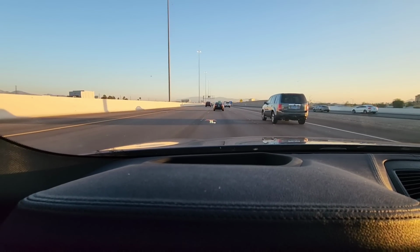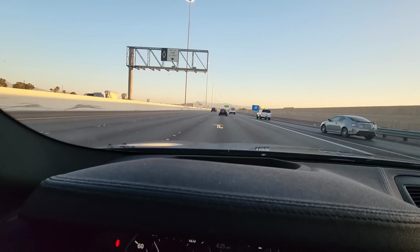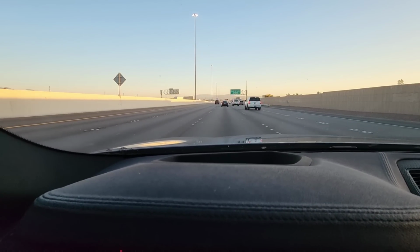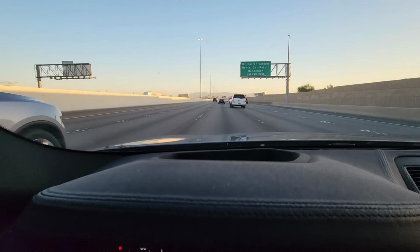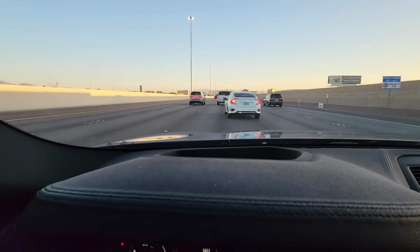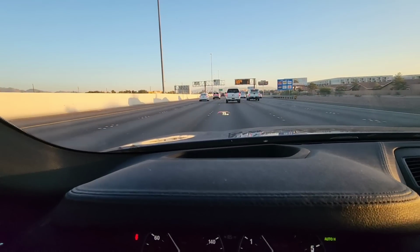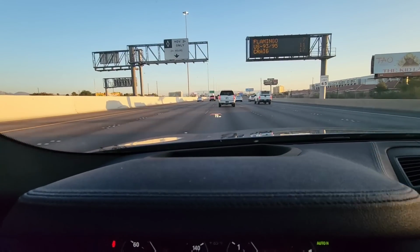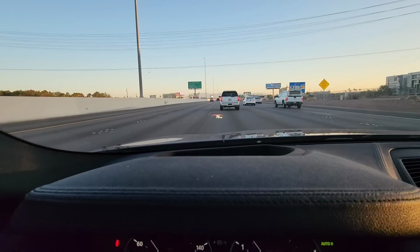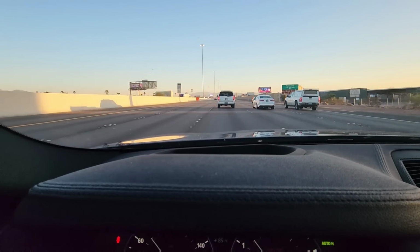Now, one of them is the right front wheel hub or bearing. It's all on how you name it when you bring it in. So my right front bearing, I'm noticing a little bit of a roar now if I transfer the weight. And if you don't know what that means, how you can tell when a bearing or hub is going bad is you lean over a little bit like this to this lane and then come back and you'll hear it. It'll go whoa, whoa, when you put the weight on it. You see what I'm saying? It will get progressively worse where it roars all the time, and that's probably right before your wheel falls off for real. So we're taking care of that.